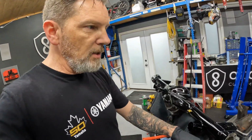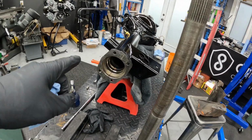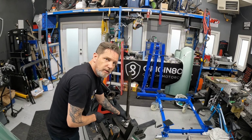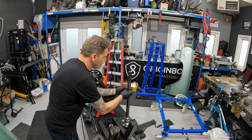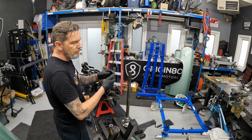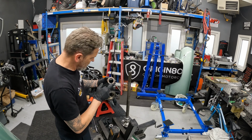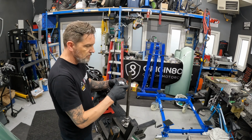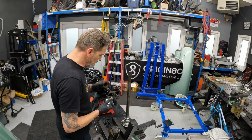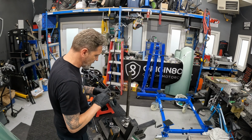But anyway, I'm gonna put this camera down, and hopefully you can see me putting this axle inside the housing. So you got to pull the seal off the axle. They put both seals on one axle just so you have them, and these go with the hollow side in, solid side out. I use a large socket, and I just center it up on there and tap it in. First I'll put some grease on this just to let it go home a little easier.